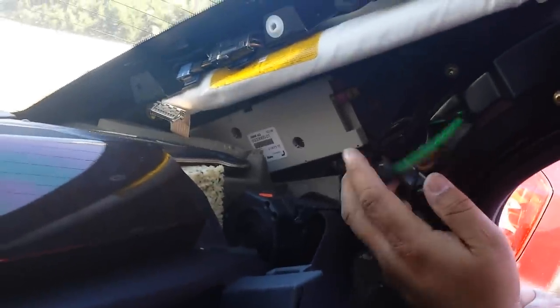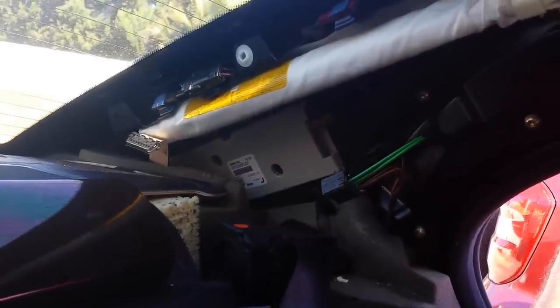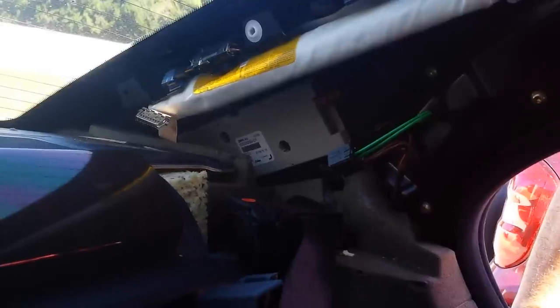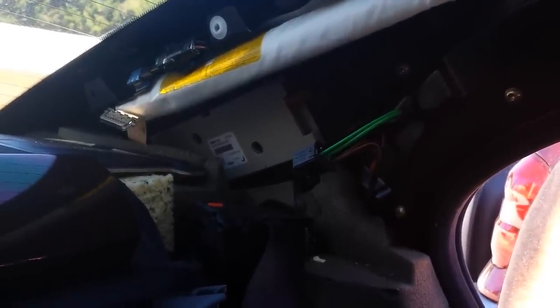If you need any repair with these tuners or antenna amplifiers, you can send it to Hitek Electronic Services in Van Nuys, California, at 818-785-8085. The common symptom for a bad tuner is that when you turn on the ignition and go to AM or FM mode, you won't be able to see the station numbers on the right hand side. Note that a bad tuner is not necessarily the cause — if the fiber optic line is open, you will have the same symptom.